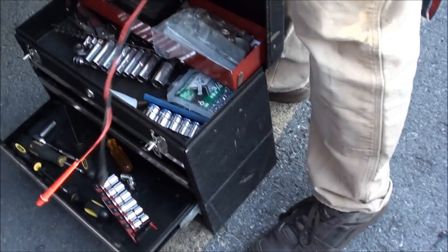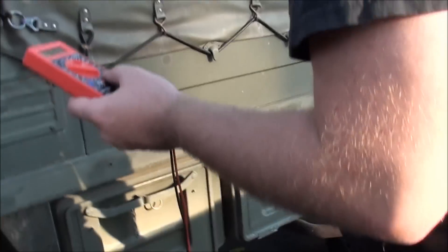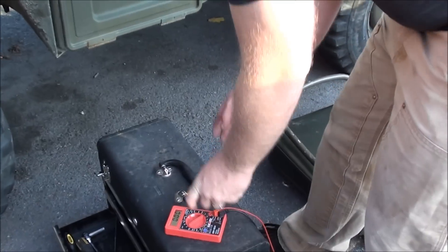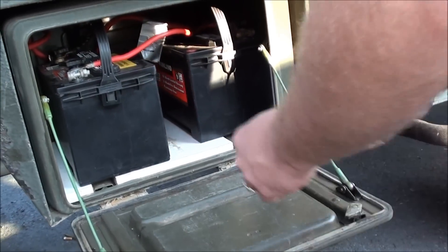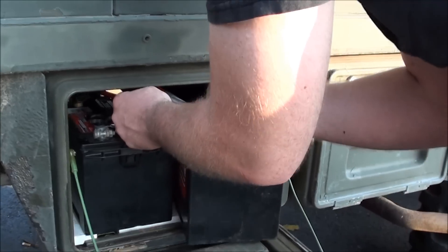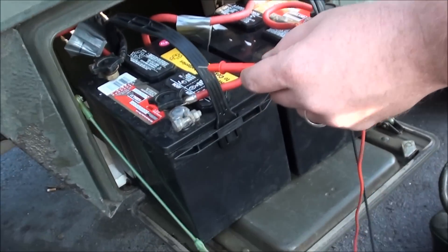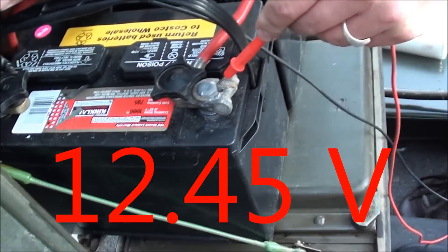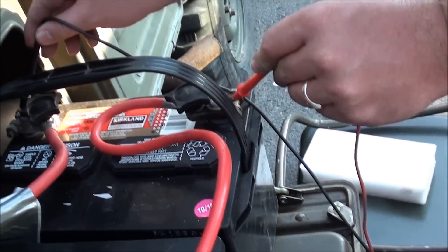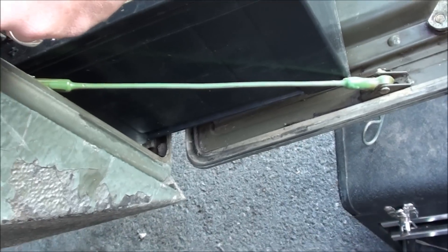We're going to check the voltage. Maybe that's Zach - he's got the transformer. First we'll check on the batteries. Whoa, brand new - well, kind of. If you blink you're gonna miss something. We'll go across one battery at a time - that one's 12.45. That one's 11.96, so one's a little better charged than the other. And whoa, that's kicking it up.